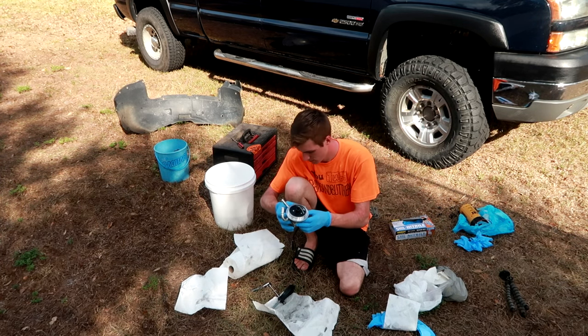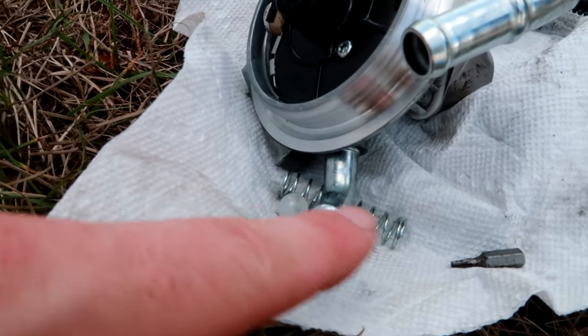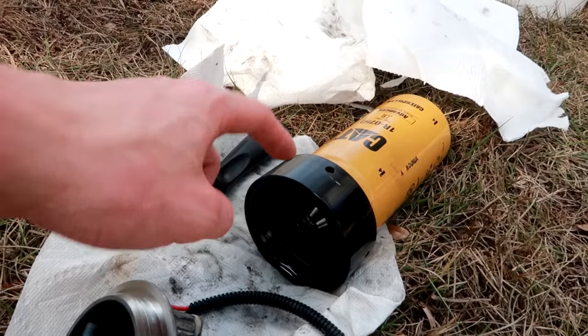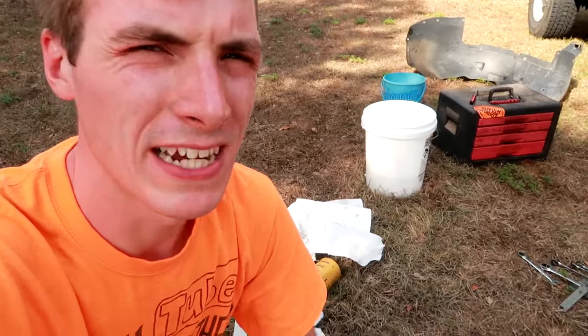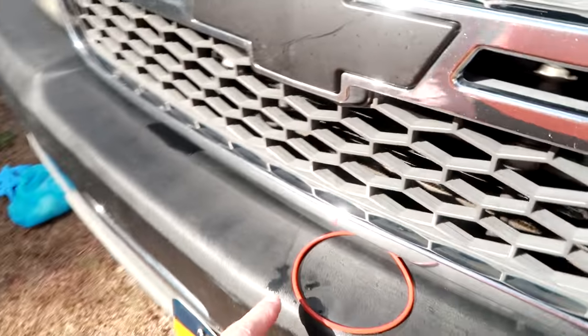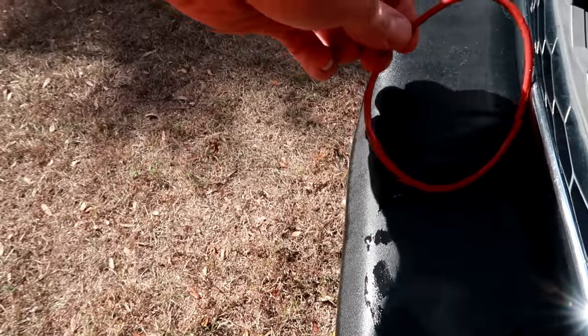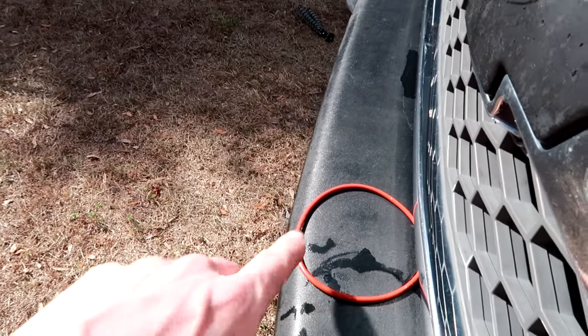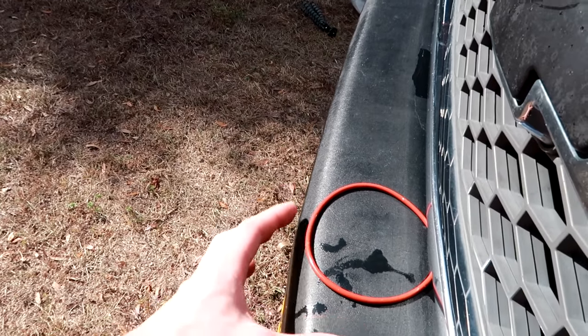That should do it. So here's the ball and here's the spring that I removed so that I can use my new filter and my new adapter. The only problem — I made one small mistake — I left this O-ring on the adapter, which means it expanded. So now I've washed the diesel fuel off with some soapy water, and I have it on a black surface so that it'll dry out and shrink.